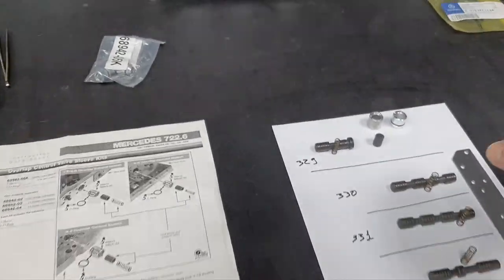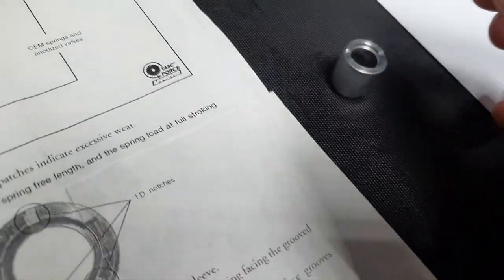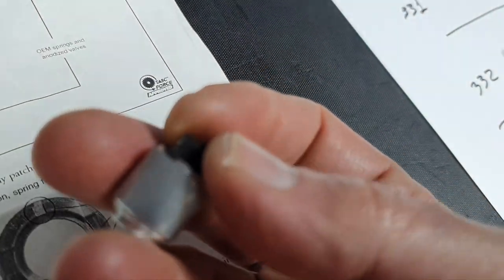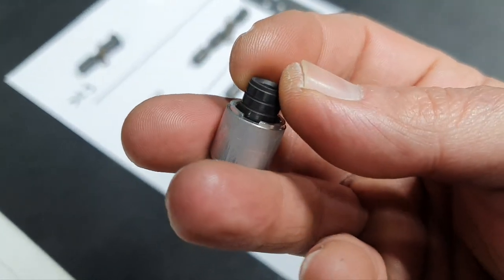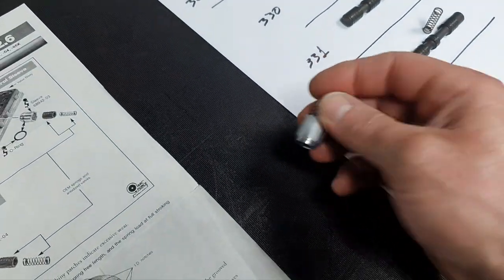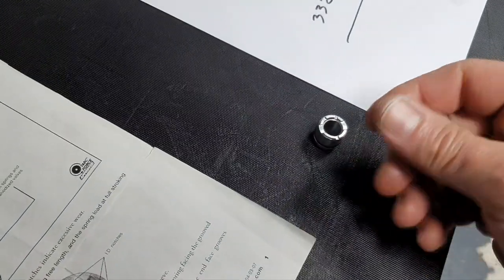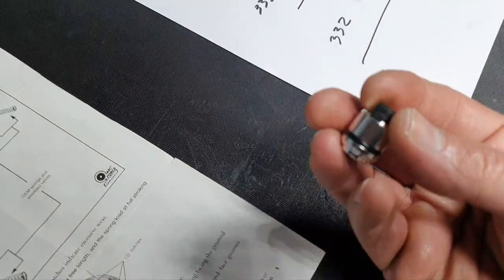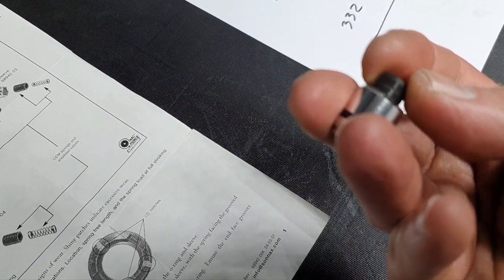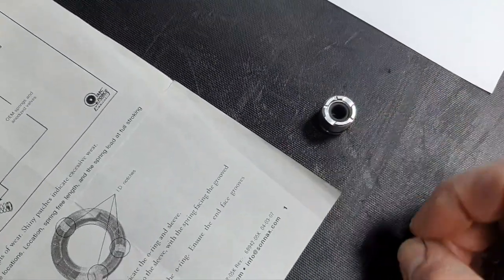Now, what I noticed. This piston, this valve, on the original sleeve, it has a tight clearance. You don't feel any movement here when you're putting it inside. It's very minimum, the clearance, all right? So if I get now the sleeve with the O-ring, and I try to do the same thing, it's playing. I don't know if you're going to see on the camera. But it's playing a lot. It's leaving enough space all around.